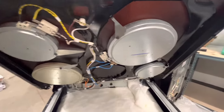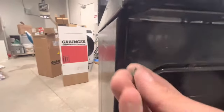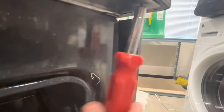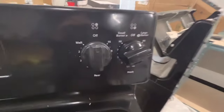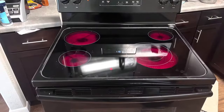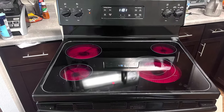After it's installed and the wires are all together, we close the stovetop and put those two screws back in to hold it down and tighten them up. Once those are on, we can power it up, turn on the power, and just make sure it works and that the burner is in the right spot. And there you go — that's how you replace a broken burner on a GE stove.